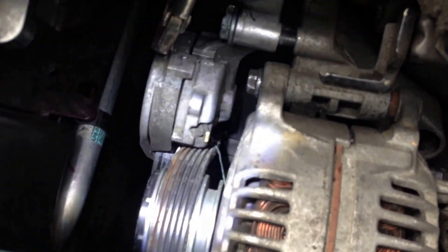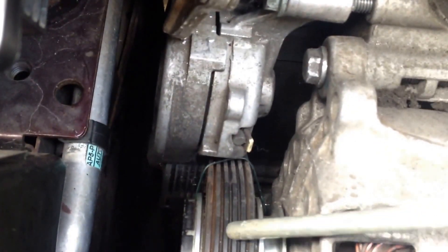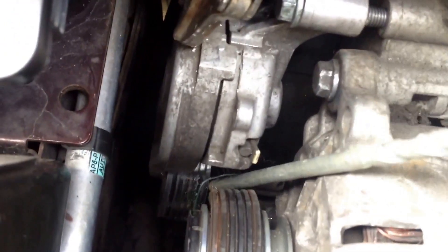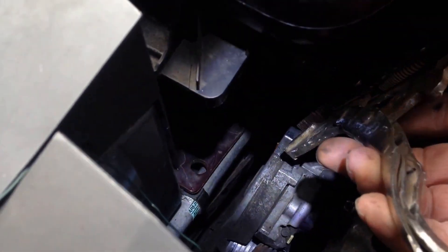So that's, in a way, said okay, this is what you've got to do. I've got a little piece of wire down here that's going to pull that plastic down and pull this belt down. There's the idler arm right there. So now what you can do is take your vice grips — there's a little knob on top of that. You put your vice grips on there and you can move the arm.